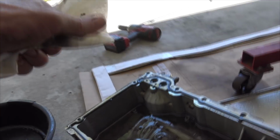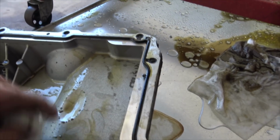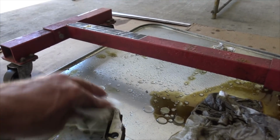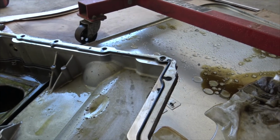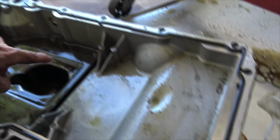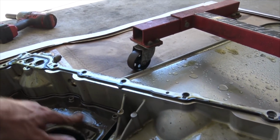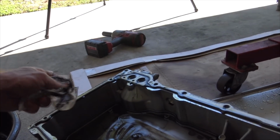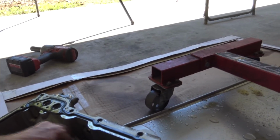You know, the oil did look fine here. It's got a nice golden color to it. But when I drained the oil, it did look a little more like graphite, I guess is the best way to describe it. Kind of a darker color oil. It wasn't golden like this stuff is. It looked a little bit like a mix. It wasn't this bad, where you can tell that's probably the ARP lube that ran off the bolts and just settled in for good. Made its permanent home there.